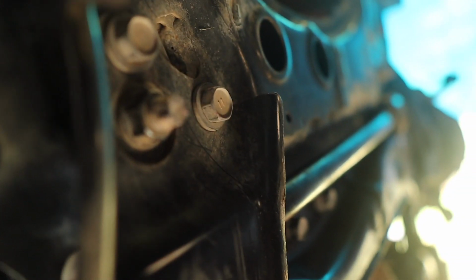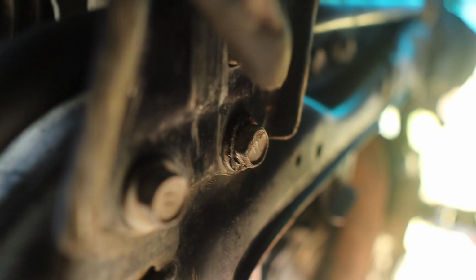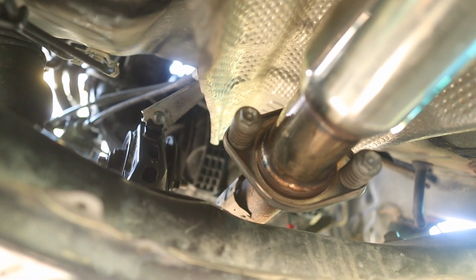Yeah, so as you can see, this one is the one that I told you, the one with 4 and the rack and pinion nut right there, as you see. And next to it, on the left side of the driver's side, there's 2 bolts right here. These 2 bolts are connecting, these 2 bolts and 2 nuts in there. I'm not sure if you can tell. I really doubt that you can. There's 2 nuts in there, and we're gonna take off the back transmission mount. So we're gonna do that, guys. Look, I'm not sure if I'm gonna be able to show you, but I'm sorry for the quality. So right here, guys, this is the transmission mount. We want to take that off.